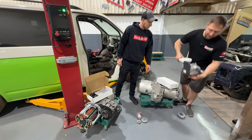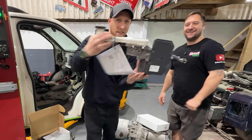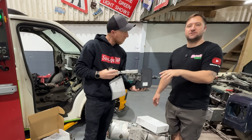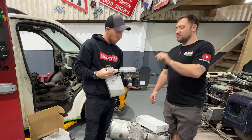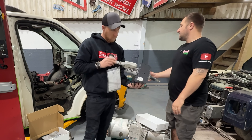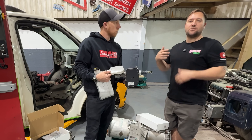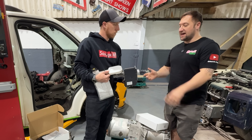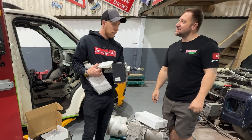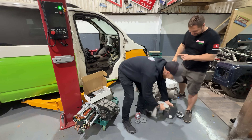This is an iBooster from a Tesla Model X, which has a very, very long tank. The reason we've chosen the earlier iBooster is because you can run these in a dumb mode — we can run them on 12 volt without all the extra control. This is going to give us extra brake pressure so that if we're running low regen, or you want regen off because you're trying to spin it in circles, the motor isn't stopping every time you let off the throttle. This ensures we can still stop this hefty beast — and stop when we've got another T5 on the trailer behind us.